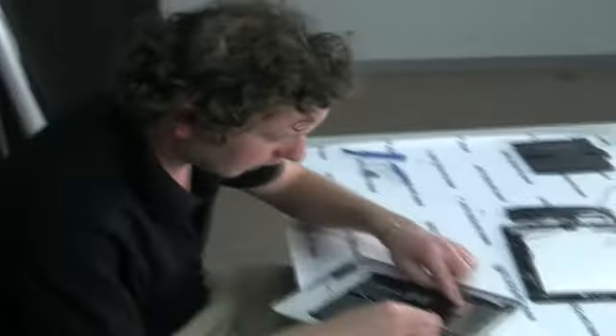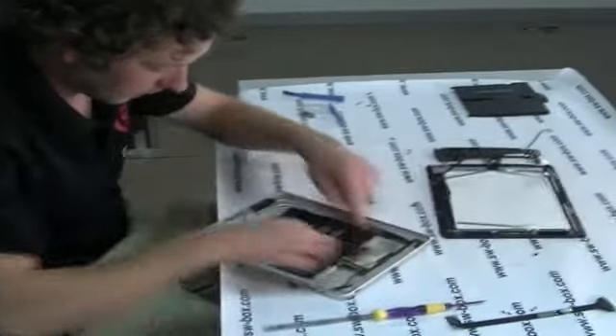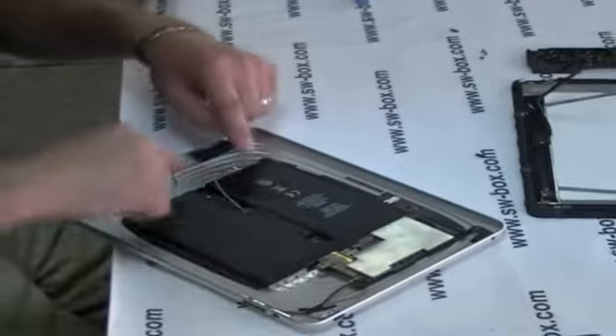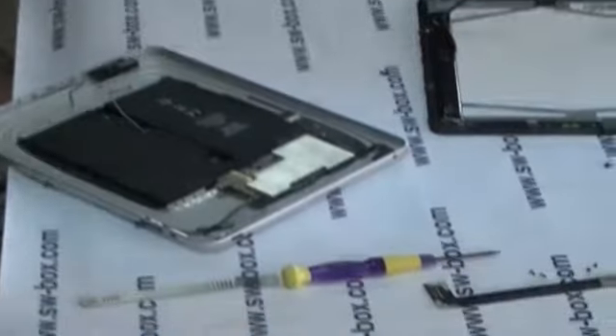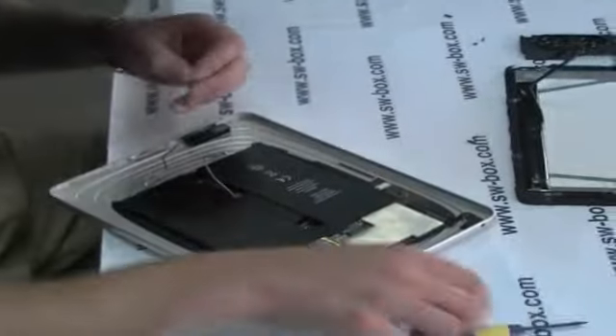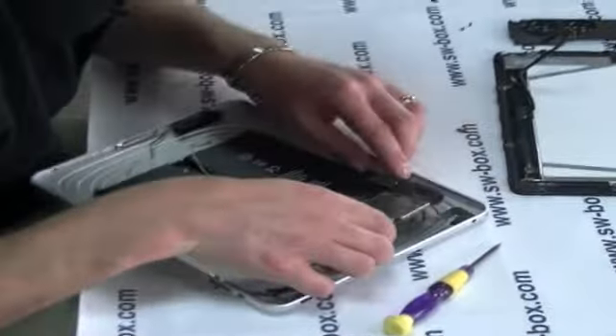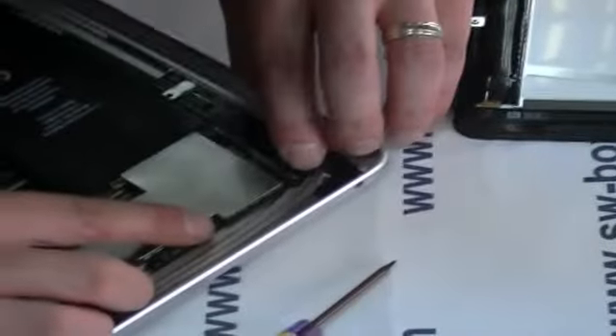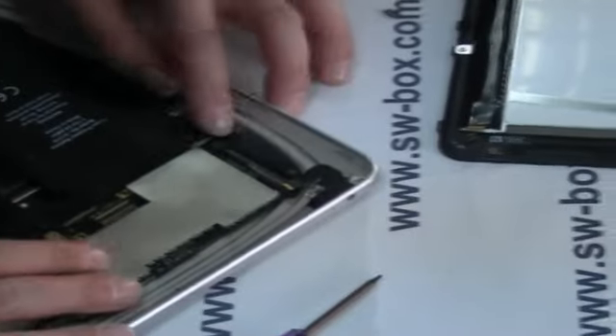You can see this is going to hold down the front of it. There are obviously screws that go in from the speakers unit, so that's going to hold the back end down. The motherboard will hold the front end down and it's going to be held down the middle by the charging port. I wouldn't bother sticking it back down at all. It's pretty amazing that something so magical is so simple. Just make sure you lift up that ribbon cable — the one that's very small — and make sure you don't trap it or you'll be backtracking again.